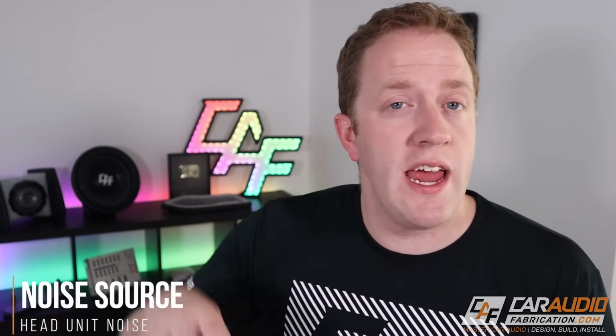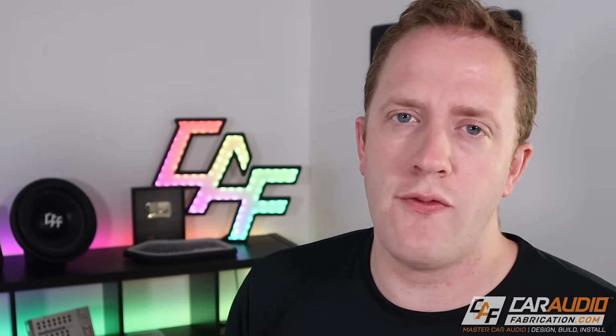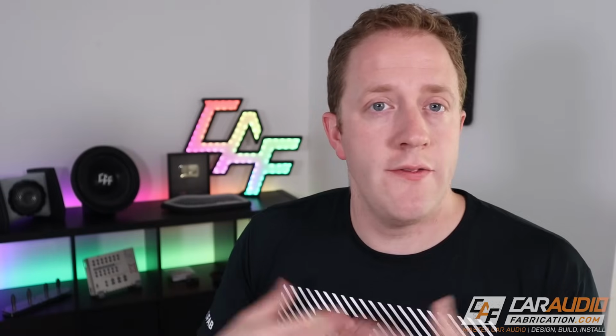Another noise type is aftermarket head unit noise. We could have a stock head unit with aftermarket amplifiers. The system could be great and noise free, and then we upgrade that stock head unit and add an aftermarket head unit and suddenly we have noise. This can happen because sometimes that stock ground connection within the dash is not good enough for the aftermarket head unit. If this occurs, you may need to extend that ground connection of the aftermarket head unit to a known good ground.